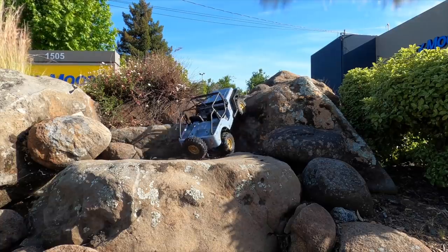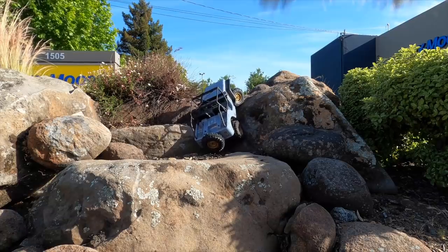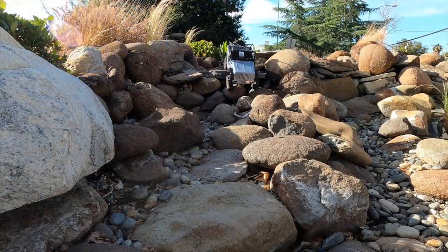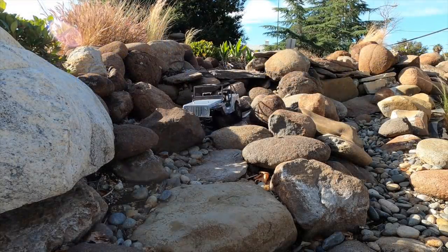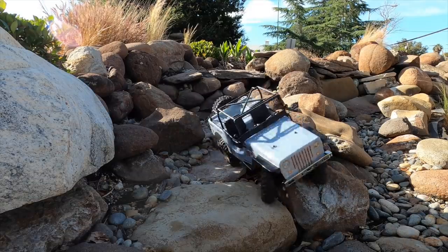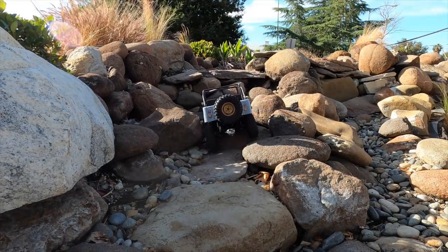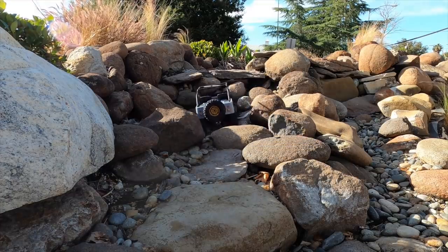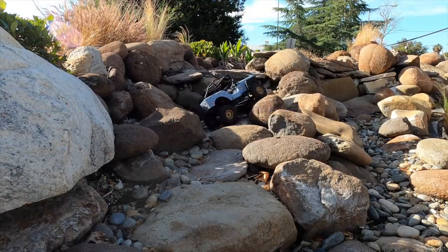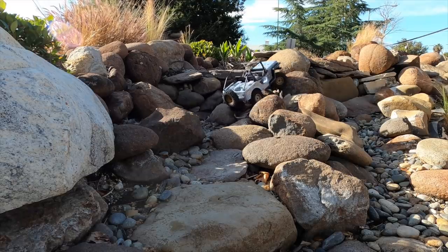But everything is upgradable, it's all standard components. So we're gonna change the wheels and tires pretty quickly and take out that spare tire. And in our next video, we are gonna do some upgrades. We have planned heavier shock coils to make this thing more stable, a little more forward weight, and then a better ESC. The Hobbywing 1080 would be a great candidate. Put some more power in that servo, because it's definitely high voltage.